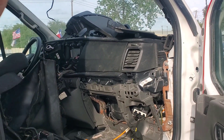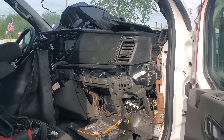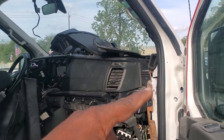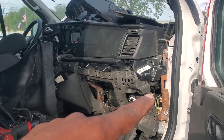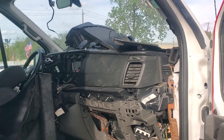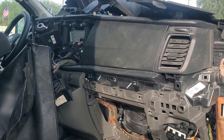We're back at the nightmare CAN bus ambulance. If you haven't seen the other two parts, go back and look. Where we left off, we did a test from the bus connector and had connectivity, but it's getting lost from there back to the gateway. We need to remove the dash to find the issue. There are seven and eight millimeter screws on this dashboard, so we're going to pull that out and continue.